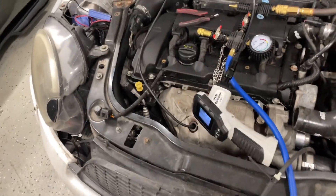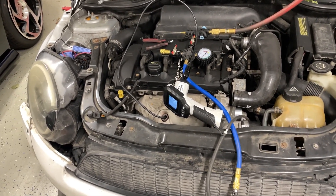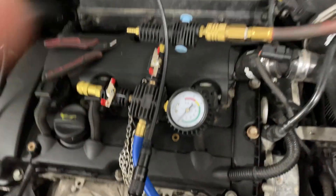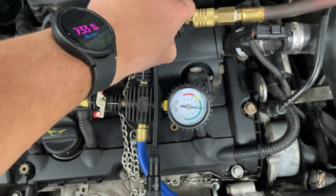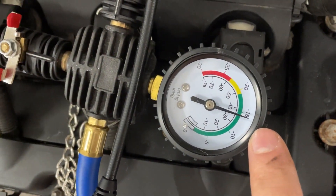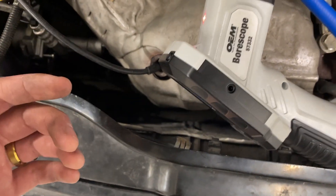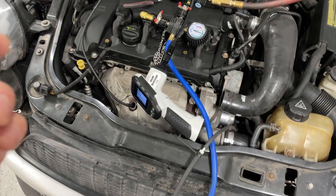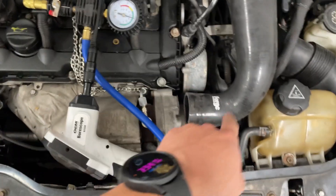I got the boroscope up close to the side but couldn't really see a gap — maybe it's not a perfect seal and maybe it's a little different when there's exhaust running through the car, but the actuator is holding vacuum. So there's nothing wrong with the actuator. If anything there might be something wrong with the wastegate flap not sealing exactly or being blown back open, but I don't really think that's it. The next step is to put everything back together and hook a gauge to the vacuum line going to the wastegate.